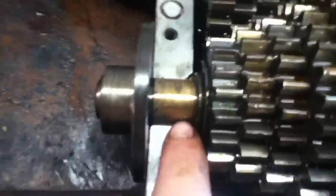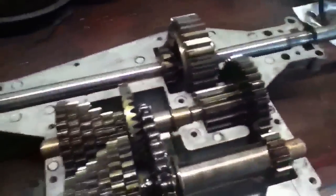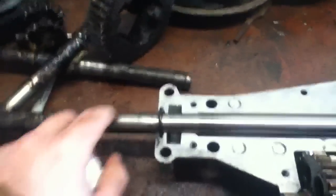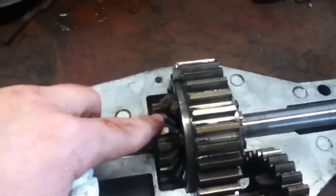Make sure when you take it apart and put it back together that you put the little notch in there. This was the transaxle that Brandon gave me - it came off of this mower, which is now my racing mower. We took it apart because the whole axle just slid out because the little clip in there broke, so I welded the gear here onto this - I did that to both of them.